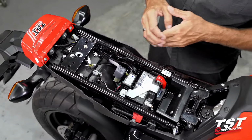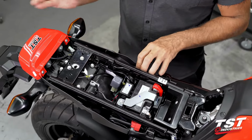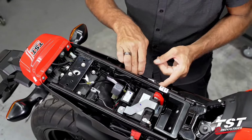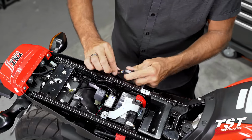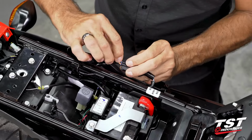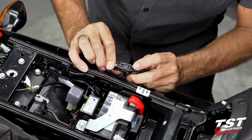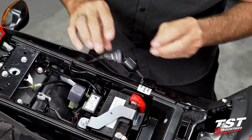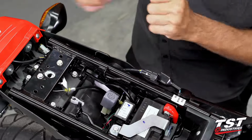At this point, we will need to find the electrical connection from the Fender equipment to the bike. It is contained on the left side of the bike. The connector is in a boot, and it looks like this. 4 conductors, yellow, blue, orange, and green wires leading into it. We need to take the boot off, and there is an unlock feature here. Press it down, pull them apart, and now this will be able to be routed back through to the underneath.